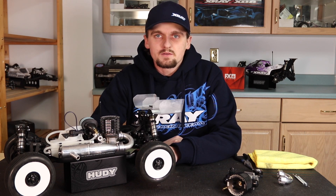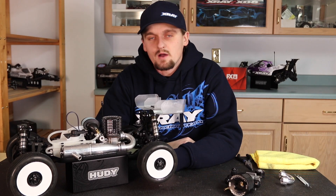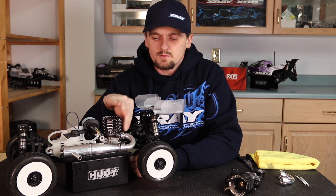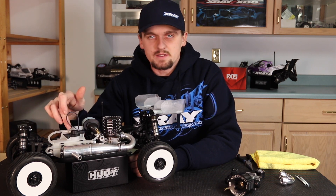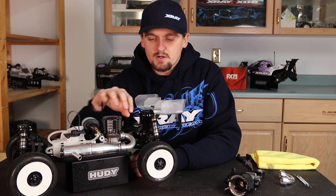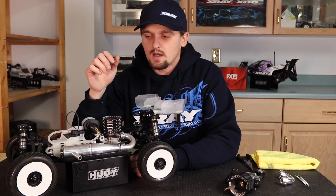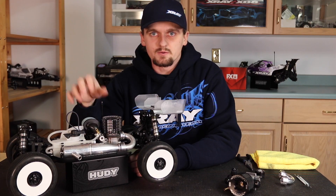Hi, my name is Ty Tesman and today we're going to do the second video in the series on how to get the most out of your nitro engine. In this video we're going to talk about the fuel system and how it works. This fuel system is a pressurized system — starting from the exhaust, which puts pressure into the tune pipe, which feeds the pressure line, puts pressure into the fuel tank, and then pushes fuel into the fuel line and into the carburetor. If any one of these parts are disrupted or hindered in any way, it's going to affect your tune a lot — you might feel like you have the wrong tune when it's really something wrong with your pressure system and fuel delivery.